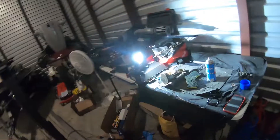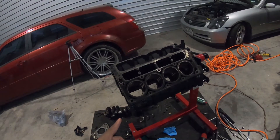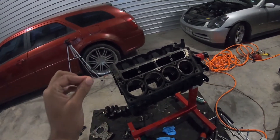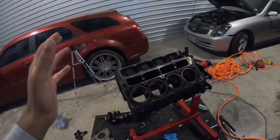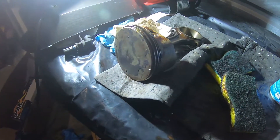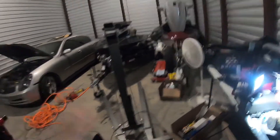As I'm cleaning these pistons off, I originally thought this motor was a 5.3 liter. With 5.3s, they have dish pistons, a bigger crank, and I believe either bigger or shorter rods — one of them, I don't remember. But I looked at this piston and it was a flat top, and I was like "huh." The place I bought it from said it was a 5.3, so now I'm kind of curious.